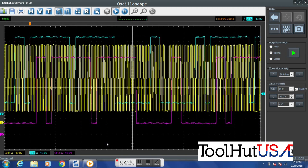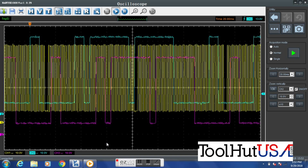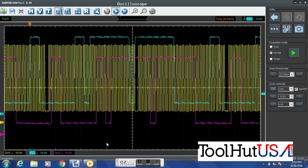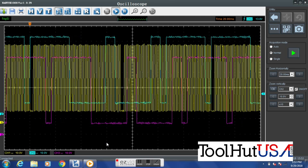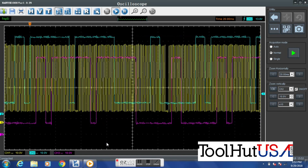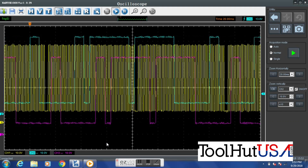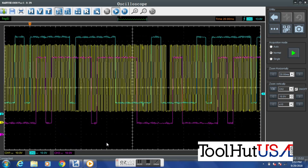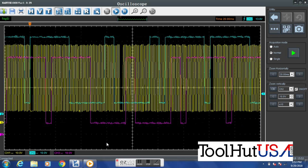I just hooked my Pico leads up to it and got it running. The car's sitting here running fine. The pattern does fuzz up a little bit — if you change the time base while it's running, it does take a minute for it to stabilize out. The biggest thing I'm struggling with is the ability to save this capture. I know you can do a screenshot or record video, but the scope software does not appear to have the ability to actually save this pattern — though I could be wrong, it could be user error. I was able to set up a trigger, but with it being a crank and two cams, I couldn't really get it stabilized well. The user interface leaves a little to be desired, but I don't think it's unusable.